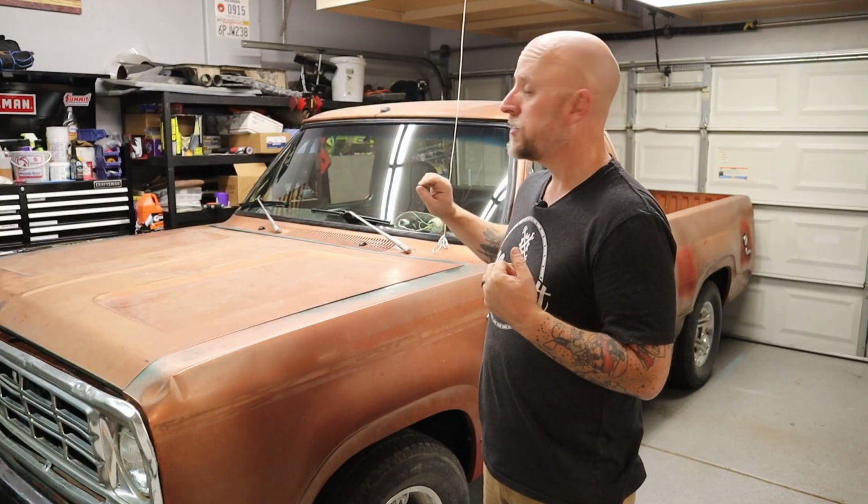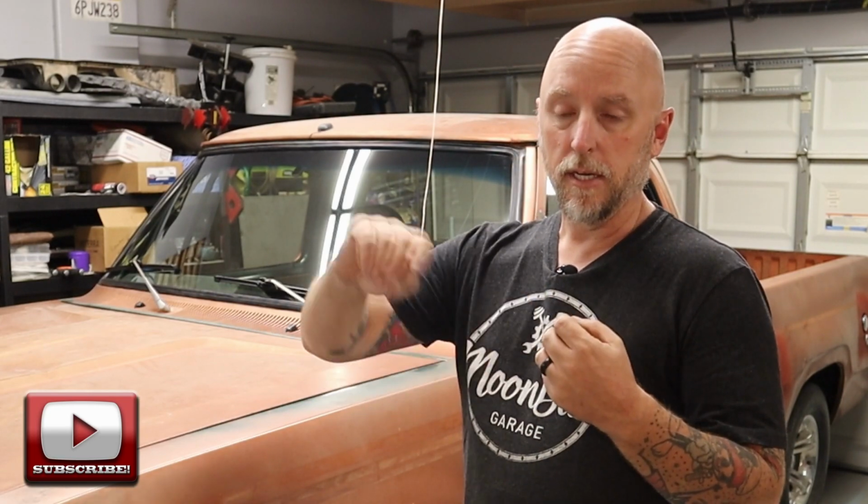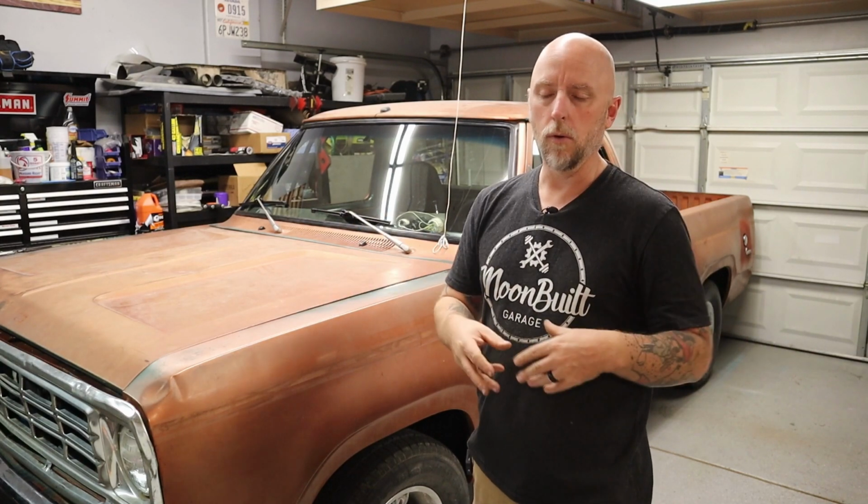So, first thing I did, I actually installed an Auto Meter fuel gauge and hooked that up. That didn't work either, even though that's a completely standalone gauge, runs off the 12 volts, doesn't plug into the dash at all. I teed the fuel level sensor signal off the dash to that gauge, nothing. So I decided, maybe I have a bad sender that could possibly, if it's shorted, be affecting the other gauge, but not the other, I don't know.